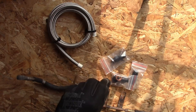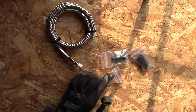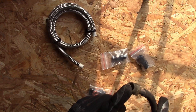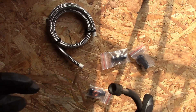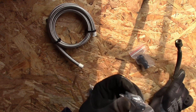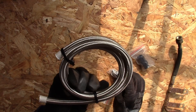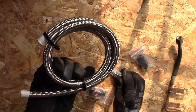I'm hopefully going to be able to build this out of this. First up is the banjo bolt fitting, one of them. For the other end I'm not going to be recreating that because I couldn't find out for sure what kind of seal it used. So instead I've got an 8mm compression fitting that will go over the hard line that will then go onto this hose. I've not assembled any of these hoses before but I've got instructions — how hard can it be? Famous last words.